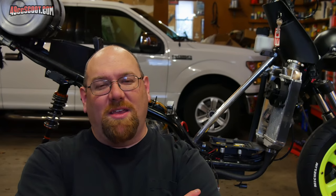I've been thinking I probably should have contacted Lectron to talk with them about a richer metering rod, or a metering rod that would allow it to be more rich at part throttle when I was cruising around. I just didn't do it. I was trying to see if I could get it in tune as is. So I'm not blaming Lectron by any stretch of the imagination. I'm just saying that I think the circumstances surrounding this probably had a lot to do with why the piston is chewed up there on the edges.